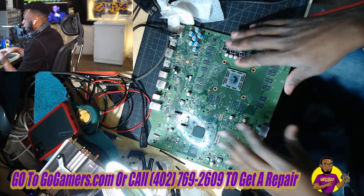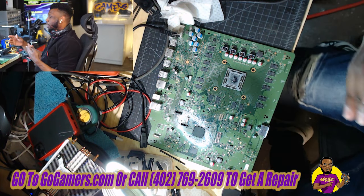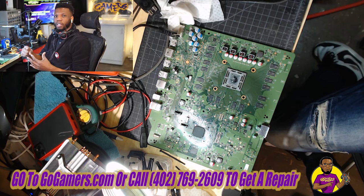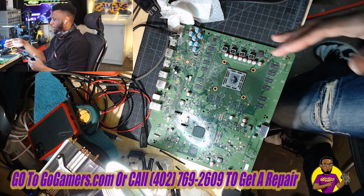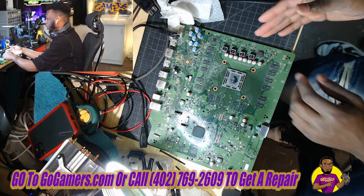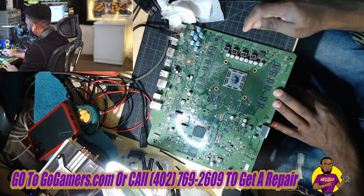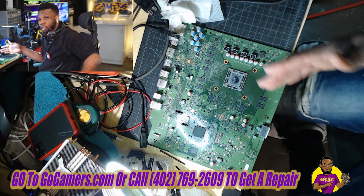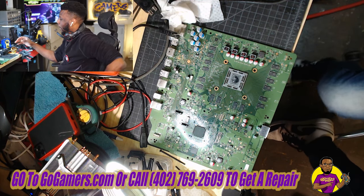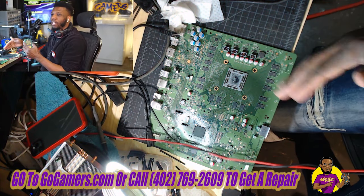Here is our motherboard — I went ahead and cleaned everything up and blew everything off. If you're comfortable taking it down to the motherboard, go ahead and do that. If not, most of the time you can get away without going all the way down, as long as you compress everything out and dry it. But if water is still underneath the heat block it could still get on your power rail. Here are your mosfets, here are your gates, here are your fuses. If water touches any of that it grounds out and will destroy the mosfet.